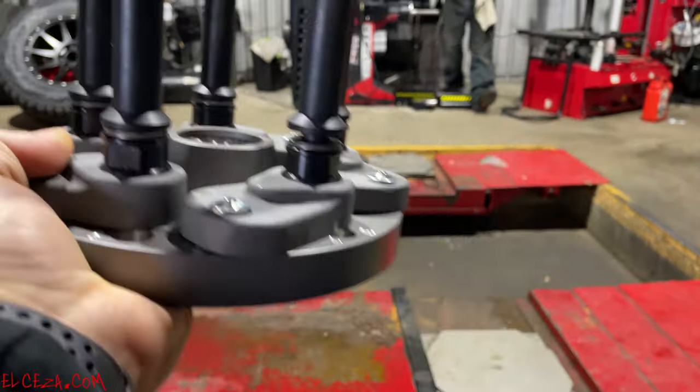I get to work on a lot of wheel lifts because guys use it to hold the wheel still when they're trying to hammer the butterfly down. Don't do that. You end up breaking it loose from the machine, wearing the bolts out, wearing all the bearings out, wearing the pins out in the wheel lift, and I get to come fix that. So, let it down. Going on the spindle stop. Wing nut is at about 1:30, 2 o'clock. Hold the wheel. That's all you need to do. Don't have to beat on it. You don't have to get a plumber to come in here on it. You do not have to do that.